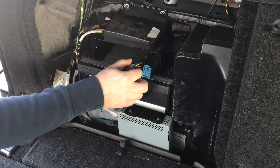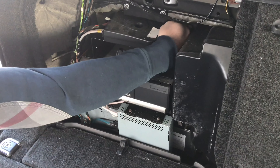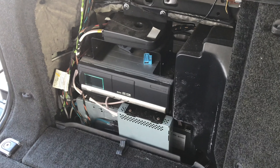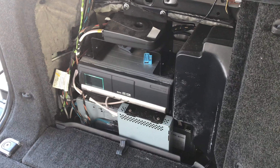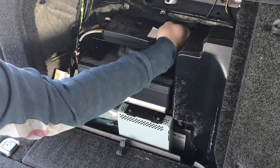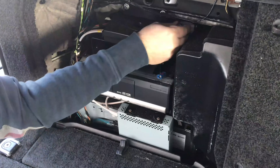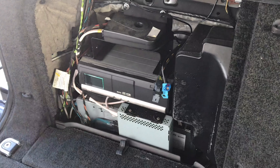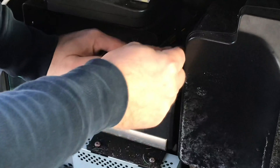When all settings are correct, click 'Save Settings' and then Close. Next are the on-screen display settings — these are the display names for each of the four camera inputs. You can label them as 'Front Camera,' 'Rear Camera,' etc. For basic four-camera setups, it's easier to leave them as the camera name. Deselect all options on the left regarding overlay text. Once happy with settings, click 'Save Settings.' Feature activation is only available in certain vehicles, so disregard it. Disconnect the interface from the computer and proceed with installation.